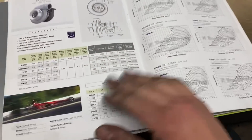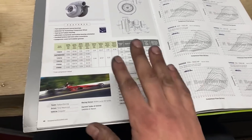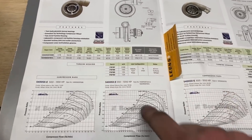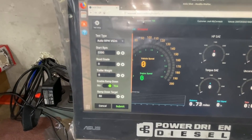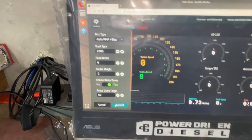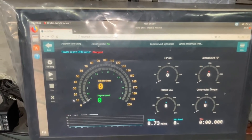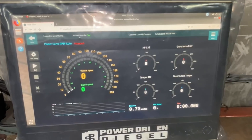This catalog - I think anybody can order these. You don't have to be anything special to get them, and they're great references especially if you're trying to figure out housings, flow maps, stuff like that - amazing resources. We've got the dyno all loaded up. We're going to start at the same 2,200 RPM that we did before - no extra trailer weight or road grade. I basically just watch the horsepower and that's when I let out. This has auto stop, which is a really nice feature.